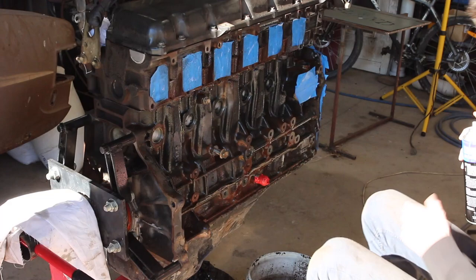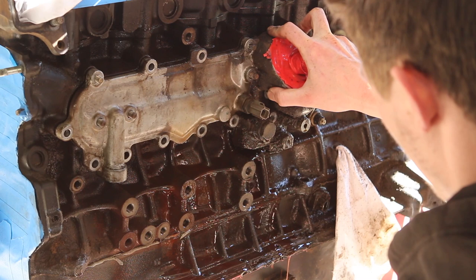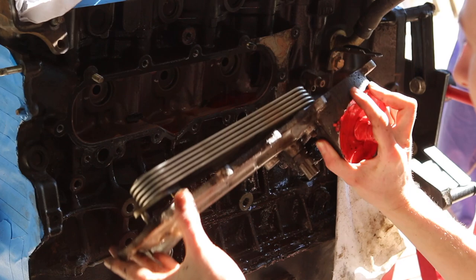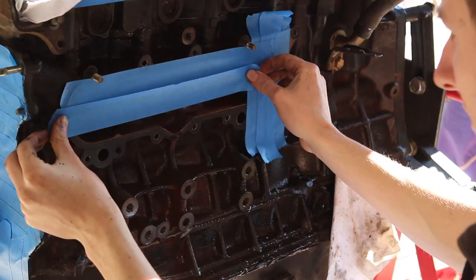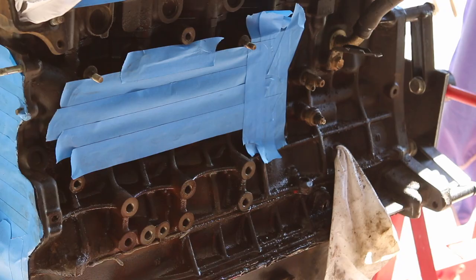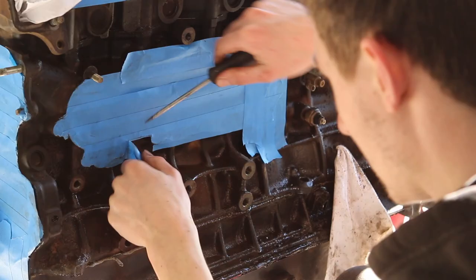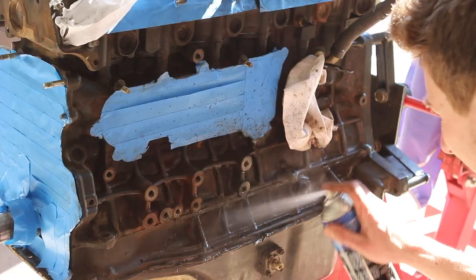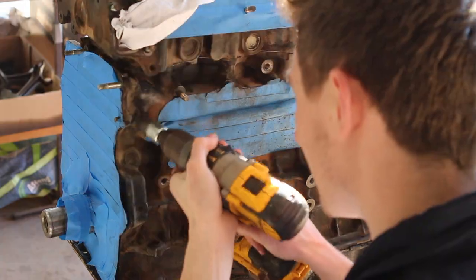The aim is to get all of the dirt, oil, and moisture out of the block. Because it's quite a porous material — cast iron — it does take a lot of work, and that's where the brake cleaner and degreaser comes in handy, especially brake cleaner because it actually evaporates. It gets into those pores and evaporates out the oil, coolant, and whatever else is in there. So just tape up the stuff you don't want covered, and repeat: brake cleaner, air nozzle, wire brush.